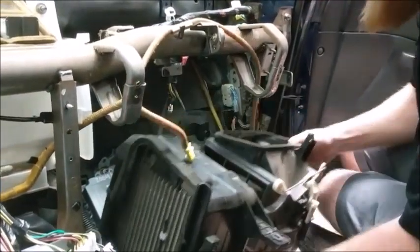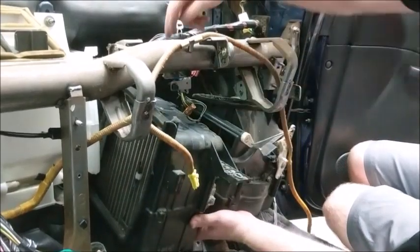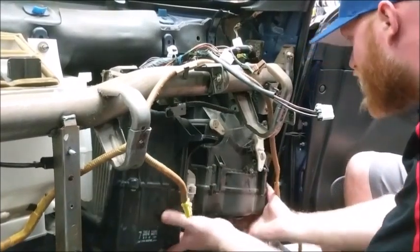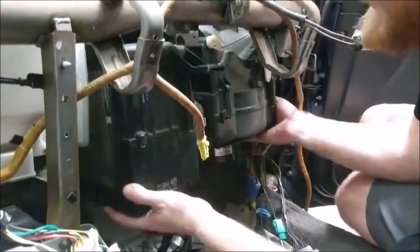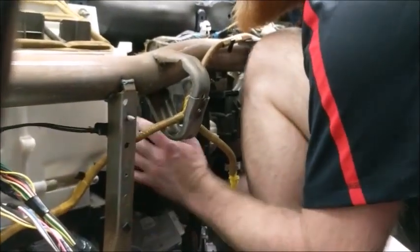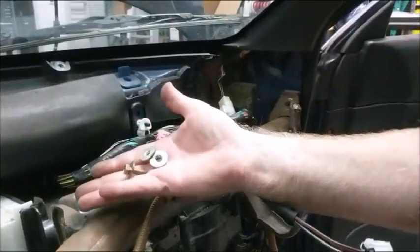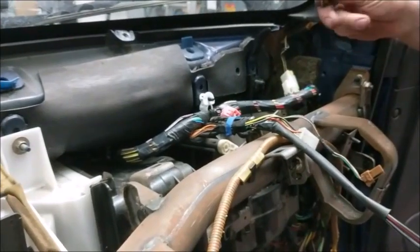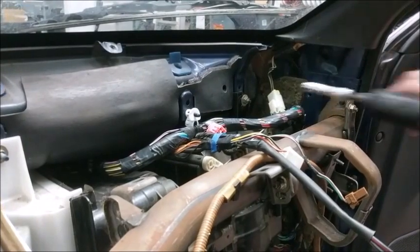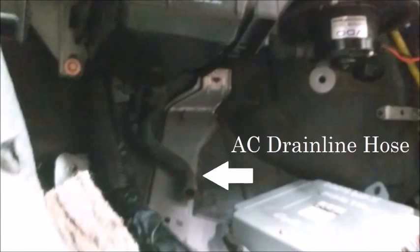Install the blower box. The white paint is sitting on top of the blower box so you don't smash it. Just wiggle the blower box until it fits into the grooves — there is a hook on the upper right side. If you have a friend, they can help you guide it through the firewall on the engine bay side. This takes a little persistence. Once the blower box is in the right place, bolt it in. The AC drain line hose needs to go through the hole above the ECU into the engine bay. This is very important so that water doesn't collect inside the car.